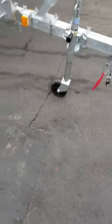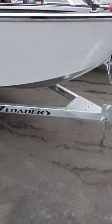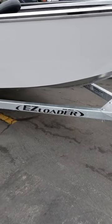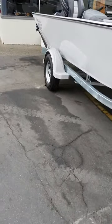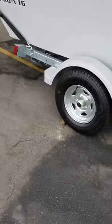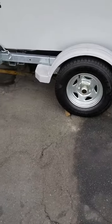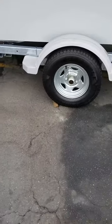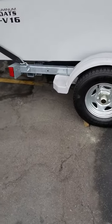The trailer is double-dip galvanized. Got a tongue jack, regular winch — looks good. You got a spare tire mount, nose spare tire. There's your serial numbers. What I would do on the last ten digits is maybe get a little Dremel tool and etch them underneath, put a little black mark on your axle in case they peel that sticker. You got Carlisle marine gray tires, ST 175/80 R13, and it's a five-lug.